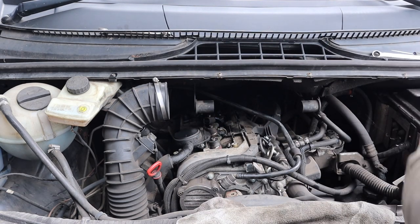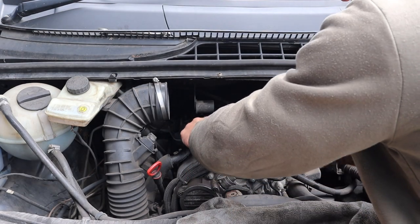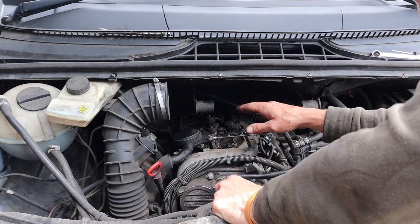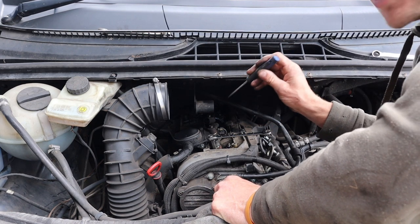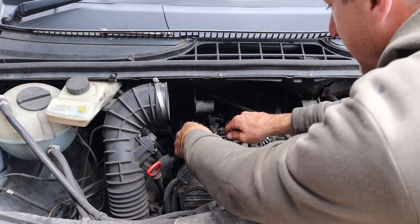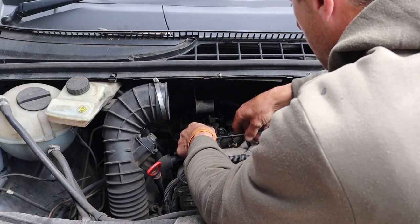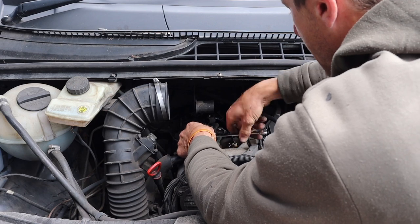All four connectors off. Now I'm using a T40 in a small bit with a 10 mil ratchet spanner — you can use any kind of T40 as long as it reaches in there. One thing to point out: if the injector seal has been chuffing for a while, there's probably a load of carbon build-up in the bolt and you'll end up rounding the Torx bit off. Get a small pick or a really small screwdriver and dig the carbon out of the bolt to make sure the T-bit goes all the way to the bottom. It's the same process for Sprinters, Vitos, C-Class, E-Class — all the same.